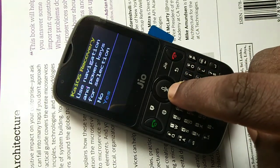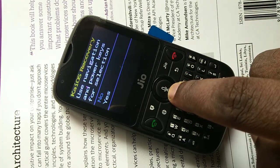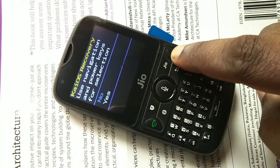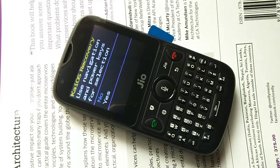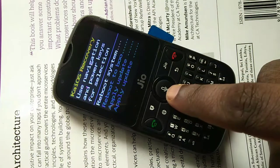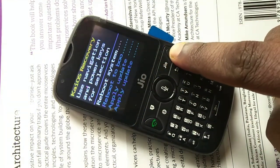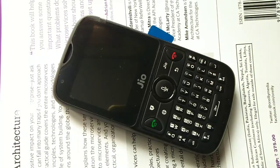Use the down navigation key to select 'yes', then press the power key. The hard reset is now successfully done. Select 'reboot system' and press the power key — the phone is now rebooting.